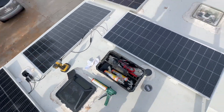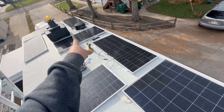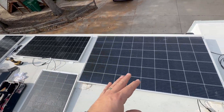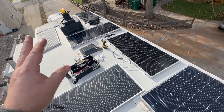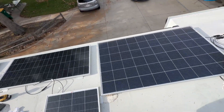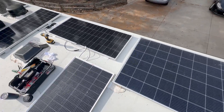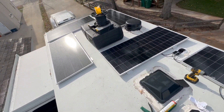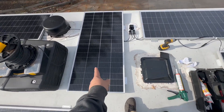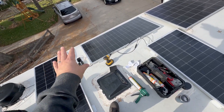That's a solar port, and that's a solar port — and they both feed down into the front bay. We didn't use that front bay area connection, but that opens us up to running two trackers and two chargers, which is going to get better performance — especially in partial shade conditions like this where that panel is going to be partially shaded almost all the time. That's going to help out so much and it just opens up options for people. I really like that Grand Design — I wish more manufacturers would do that. If that wasn't the case, there is a satellite prep port here we could have used, or one of the vents, or just added a normal port ourselves. But having that already done is huge.